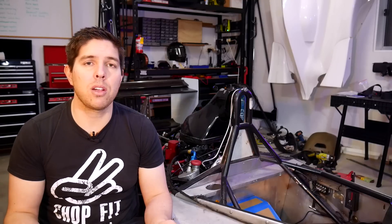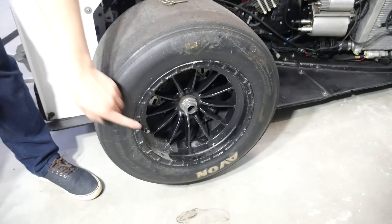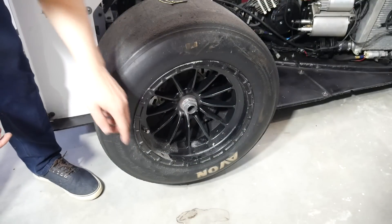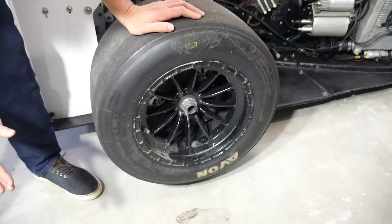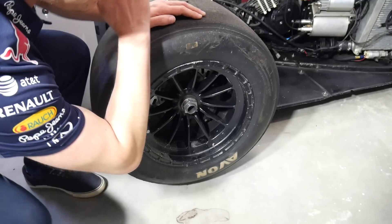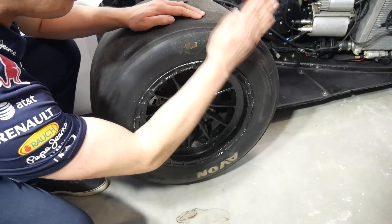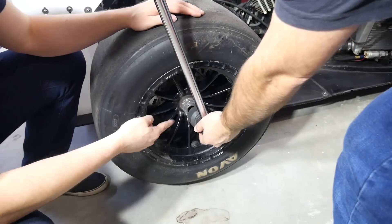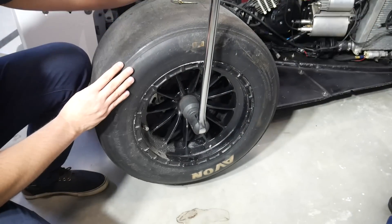The problem I'm solving in this video was something I just didn't think about until I owned the car. Unlike a road car that has several wheel nuts, my race car has a single centre nut per corner, kind of like in Formula 1. The threads are actually opposite from the left and right hand side of the car, but we always need to twist towards the front of the car to loosen and towards the rear to tighten. Obviously, the wheels not falling off is kind of important, so the first step was to find the right size socket to fit my nut.